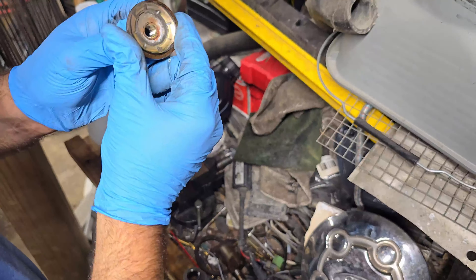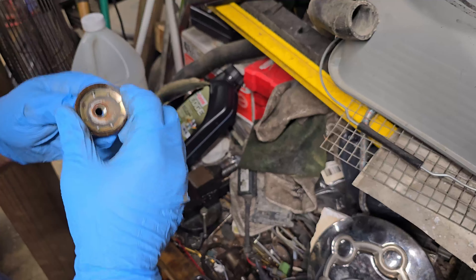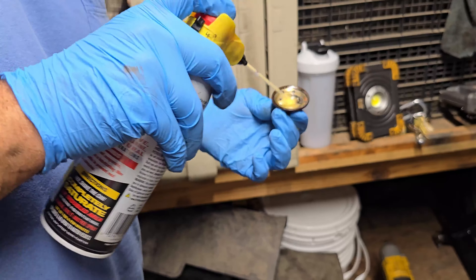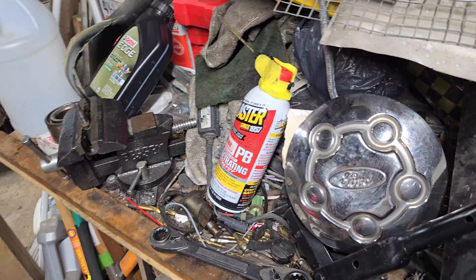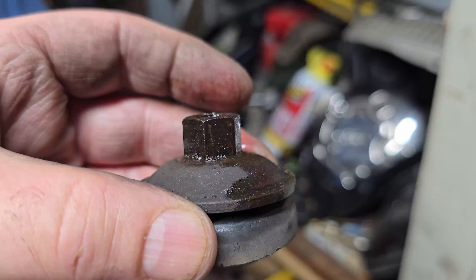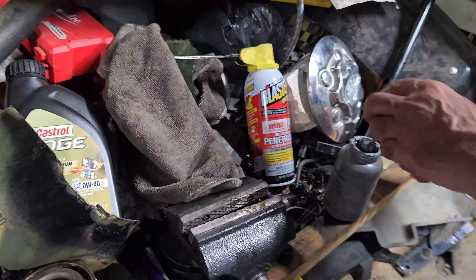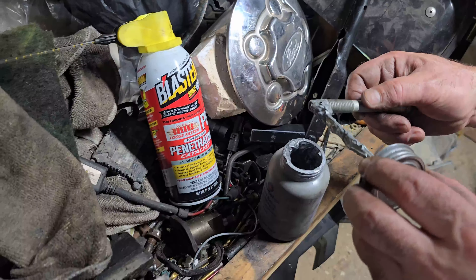You can see it's all one piece, but it's actually a bit seized up — it should move freely. We're going to hit it with a little bit of penetrating lubricant to try to free it up. This piece is going to accept the same piece it had underneath it, and it's going to go right on top of the new shock, making everything fit perfectly. To make life easier taking it off next time, we're going to put a little bit of anti-seize on the bolt to prevent it from seizing and rusting.